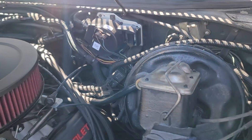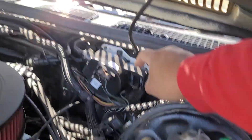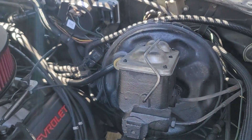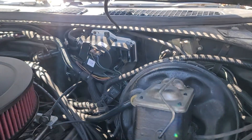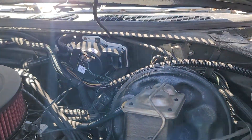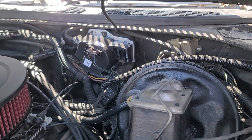When I tell you it's super easy to install — and then when you get the old one out, what I would recommend is actually greasing up the gears that are on the motor. Since you're already in there, just grease up the gears and you're all good. It's like a little plastic gear that's in there. So yeah, that's the gist of what I did to put the new one on and what prompted me to get the new one.